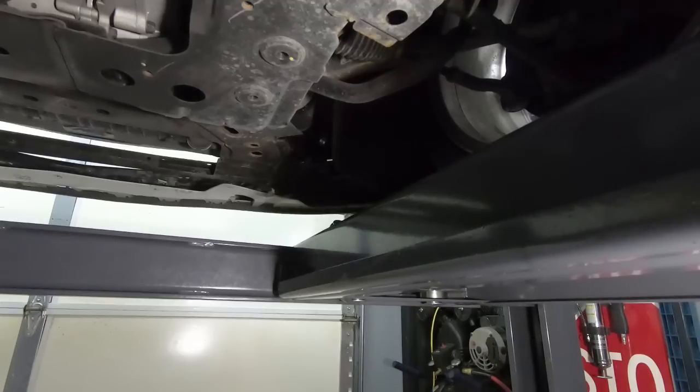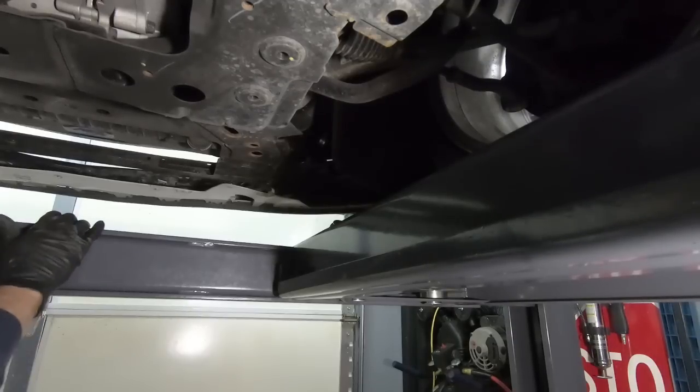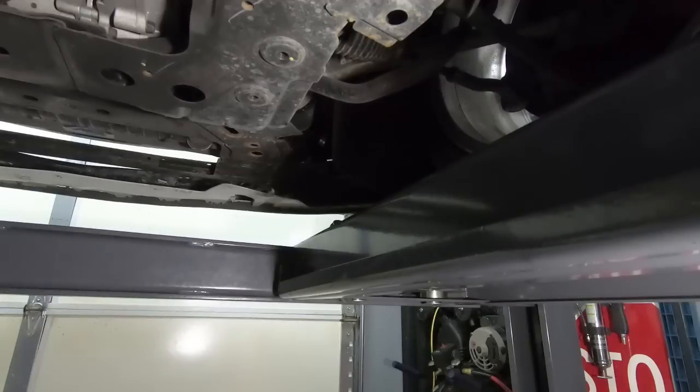You can see we got an AFCO heat exchanger, which is nice. But we should be able to see now some of the things that we're gonna have to take apart. I'm really hoping not to have to take the front bumper off this, but I'm pretty sure I'm gonna have to in order to get the cam out. Now I know there's people that have taken the cam out without doing it, but because of the heat exchanger and whatnot, I'm pretty sure we're gonna have to take a lot of that loose. But we're gonna see what we wanna work on next.